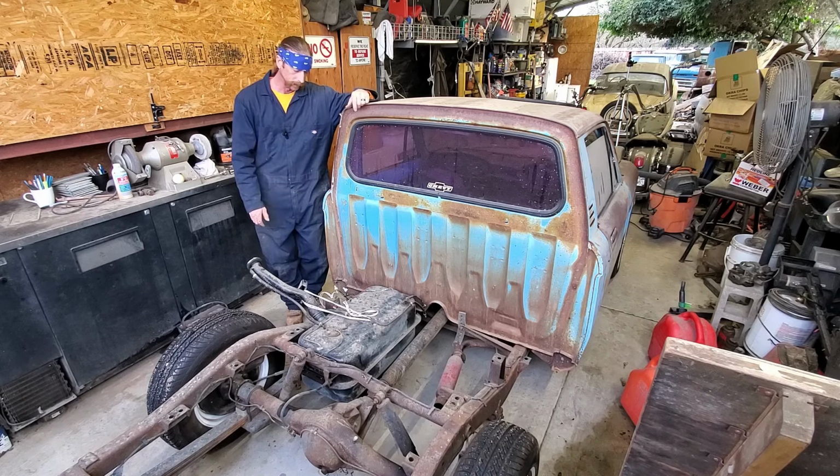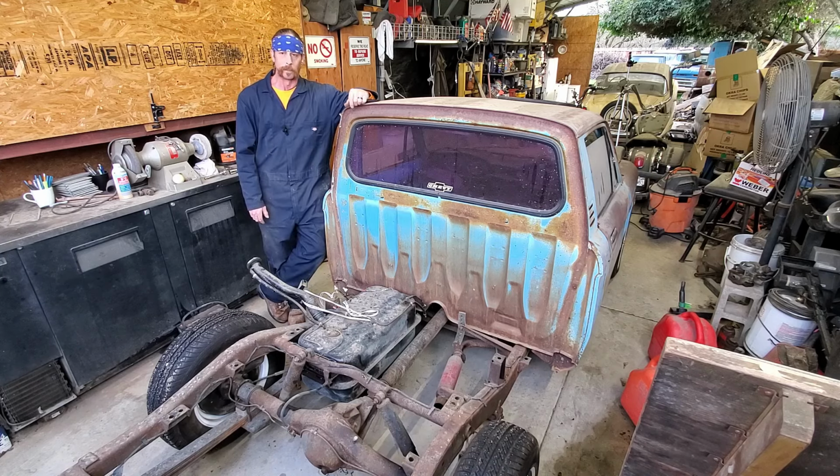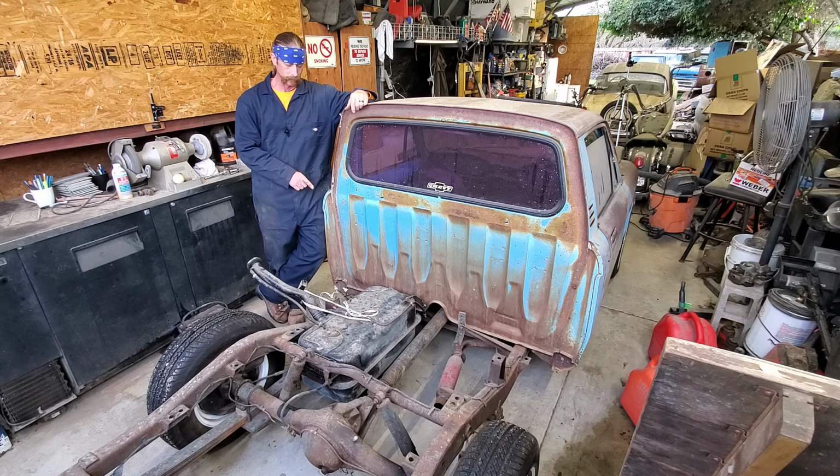So I don't know. Anyway, I'm going to see if I can get this tank pulled out, flush it out, make sure that's clean, the pickup's clean, it's not plugging up the pickup tube, and then toss it back in. I got another fuel pump. Different people, obviously, you get different opinions, but I'm not sure what the PSI is on this pump that's currently in here. It's one I got from O'Reilly's for a Chevy Luv. But I ordered another one.